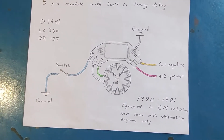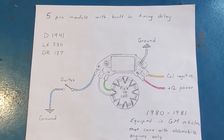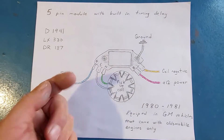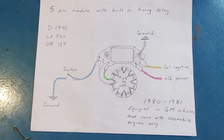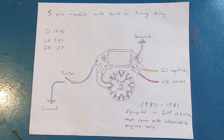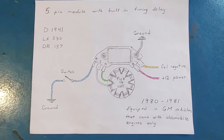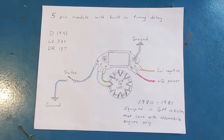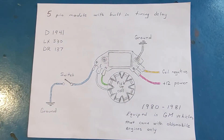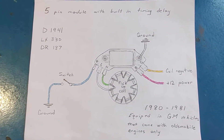I like to use this ignition module when I just want to run cheap gas. Then when the weekend comes around and I want to do a little drag racing at the strip, I'll put some octane booster in or put some high-octane fuel in the gas tank and basically open that switch. Then it'll run five degrees more advanced than with the switch closed. When you've got more timing, that gives you more power — as long as you've got the right octane in your gas tank. You can get more power at the flick of a switch — you don't have to pop the hood, get out your timing gun, turn the distributor, and time it. You can literally just flick that switch on the go for that easy change in ignition timing.